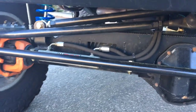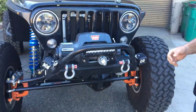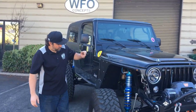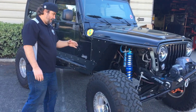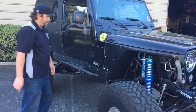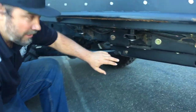The rear is a full-width 14 bolt with factory disc brakes. As you walk around on this thing, we kept it pretty simple. It's got 12-inch, two-and-a-half-inch King coilovers with our universal shock towers for TJ on the front. It's a three-link front, Curry anti-rock sway bar, and PSC hydro assist.